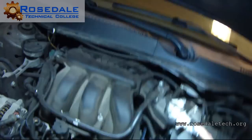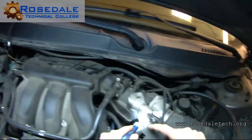Here's what you do. That's an idle air control valve. I know that because I'm looking at the throttle shaft, which is right here, and that runs all the way through the other side and puts my TPS right here. So your connector's on the back side, which means it's going to be a little more difficult to do. We can still do it if you want, or we can do it tomorrow. It being 1:30, do you want to do it? All right, you were just on the wrong component.